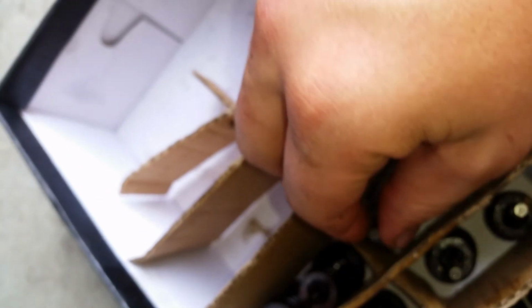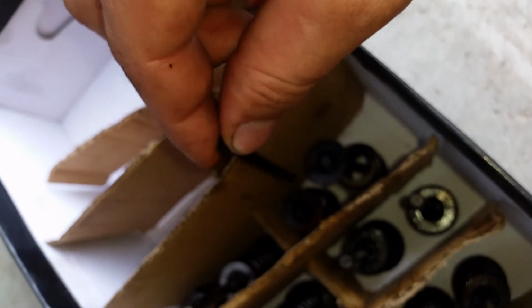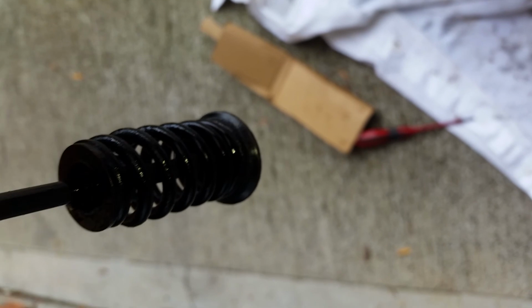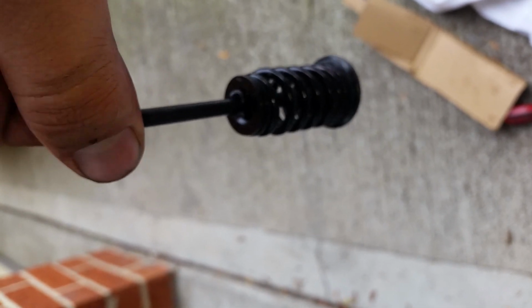And over here are the valves. So we can see again, that's out of cylinder 1. And nice clean cut, which was not healthy. But if we pull over, so again, intake, exhaust, if we pull out this one here, it's very filthy, very dirty, black. There's a bit of a wobble, so I think the valve may be bent a little bit, which I can visually see. You guys might not be able to see, but that's a new valve as well. New valve, new springs, full head rebuild, new head. Cost effective, love it.